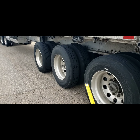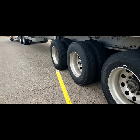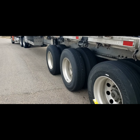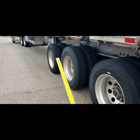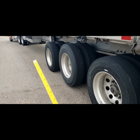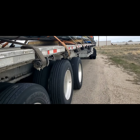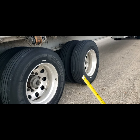We're still playing with them a bit. I can adjust them with the leveling valve back here depending on how much ride I want to give it, and I just haven't found quite the right spot yet. We do get some scuffing. When I got the spread going I get like zero scuffing on these tires, but if I lift that axle up and I'm just running on a tandem we do get a little bit of scuffing. Some of them approaches — like the bridge approaches — they are rough, almost like two feet tall it seems like, so you hit them and sometimes you do catch.